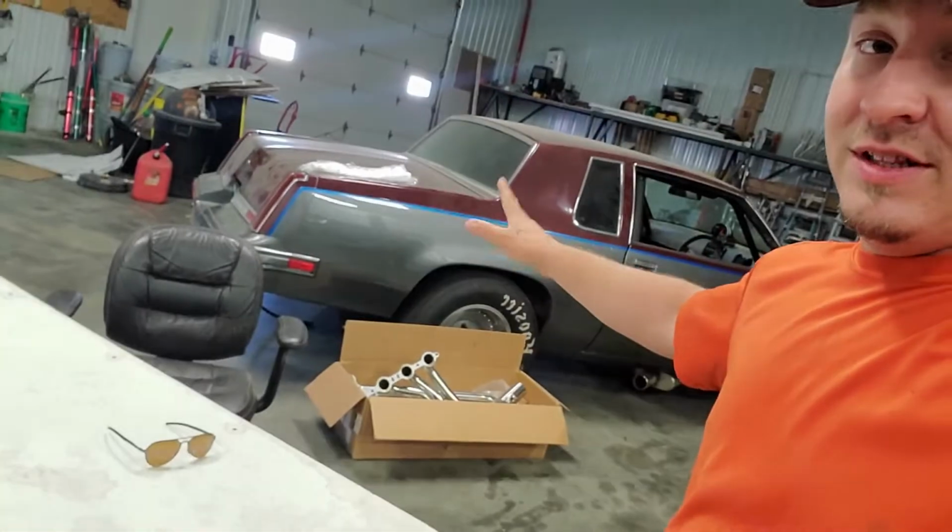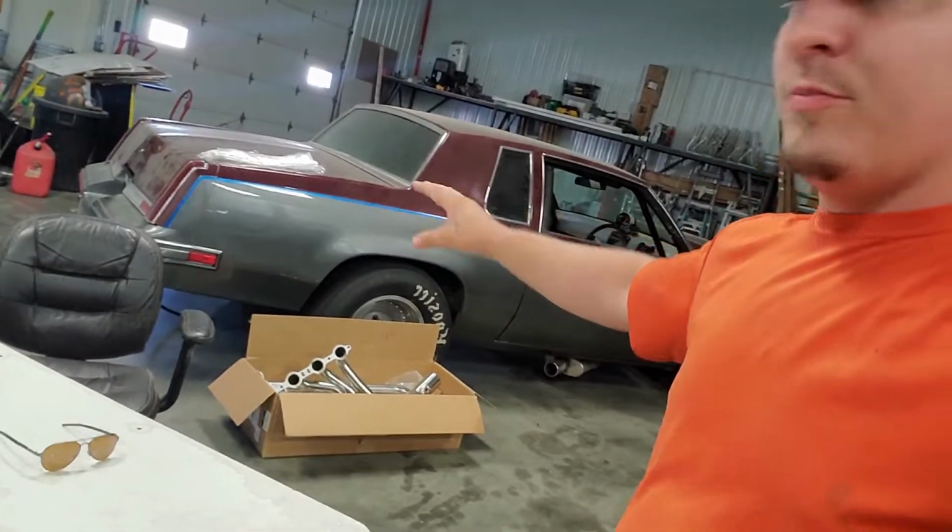I do have a set of 210cc Bosch injectors for that from VS Racing. We're going to throw those in. We're working on plumbing the second fuel pump. It's a Holley 100-pound pump that I had laying around. That's going to run in line with the MagnaFuel 4303 that's in there now.